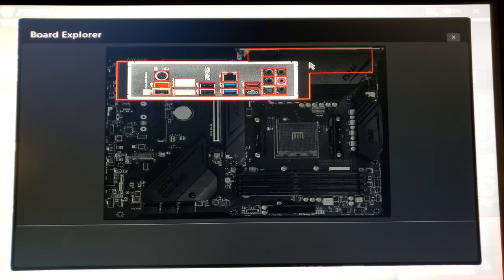On this side, I am using a USB port right over here, so it turns out these two ports are indeed USB 2.0 ports. Being as it may, those USB ports are very likely going to be controlled directly from the CPU or the chipset. So this may make life a little difficult for enthusiasts who are trying to install Windows 7 on that, and I'll definitely get into that later in another video.